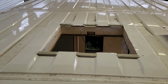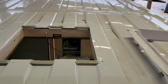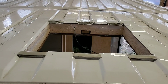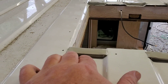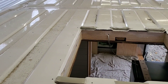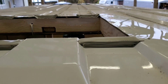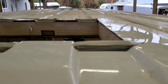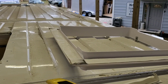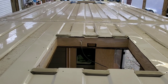Our paint's all dry. I've got the ring here all prepped — I've got butyl tape on it, all the holes are pre-drilled. For back here where the ribs are, they sell pre-made plastic pieces to go in there, and if you want to purchase them, that's entirely up to you. But I just fold butyl tape enough to fill the ridge a little high. After it's screwed down, I've got butyl tape all the way around the ring. After it's screwed down and covered with Dicor, it's not going anywhere.